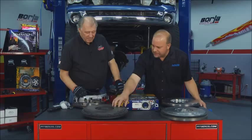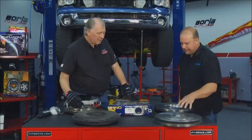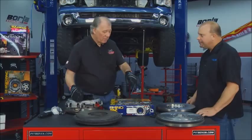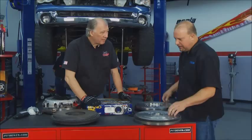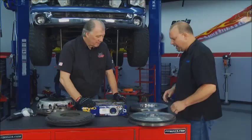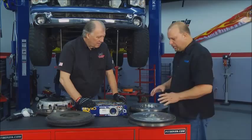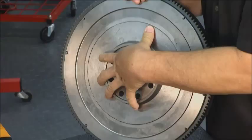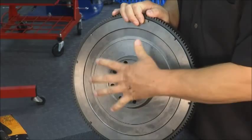One of the things we've come out with is a solid conversion kit for those. I've got a Generation 1 conversion kit and a Generation 2 conversion kit. On the Generation 1, when you had the dual-mass flywheel in the vehicle, there was an adapter plate mounted between the crankshaft and the dual-mass flywheel — we've machined the Gen 1 flywheel so that adapter plate can be used. As time went on, dealers were losing those adapter plates, so on the Generation 2 we've machined the adapter plate directly into the flywheel engineering, so you won't have to use a separate adapter plate.